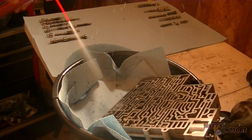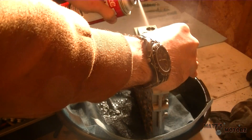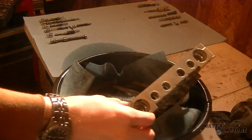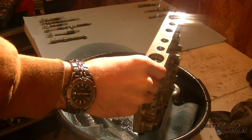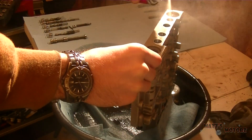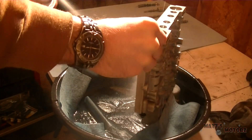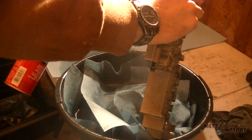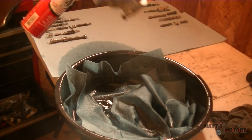So I'm just going to put the valve body in this pan here and just spray the crap out of it. With brake clean you can see how black all that fluid is. I should probably be wearing gloves, but I didn't have any — it's best to wear gloves. Spraying all the bores, make sure all the gunk is out of there. Look inside all the deep crevices — there could be a lot of dirt and friction material caked on in the deep crevices.